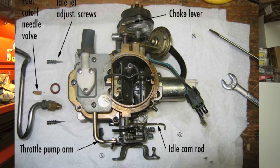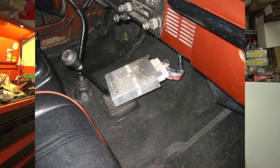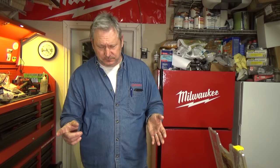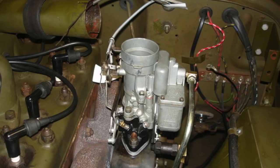Here's a picture of the carburetor that's on Devin's Jeep — it's called a Carter BBD. You can see there's a stepper motor on the back and all kinds of electronics. It communicates with the ECM, which adjusts the timing — if the vacuum is off, it can cause it to mess up. When you try to adjust this carburetor and anything's off, it'll cause the mixture needles to be unadjusted, which is why you have such a hard time with takeoff or idling. The BBD stands for Ball and Ball Dual — Ball and Ball was a company Carter originally bought out. Carter was the manufacturer for the carburetors for all the old Jeeps used in World War II, even the waterproof ones. But this design that AMC came out with to meet emission controls is a piece of crap.